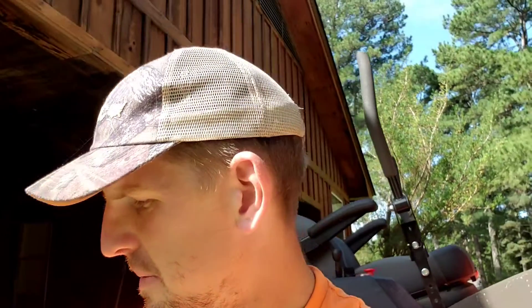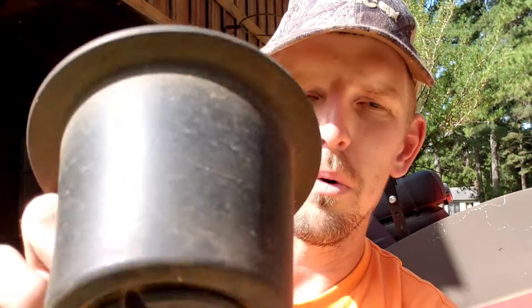That's what I wanted you to see, if your mower has these. Now, some old John Deers I've run had these cups, but they didn't have holes in the bottom — they held grease for your spindles. Now that's different; you may want to keep them. But if it's just for the purpose of a dust shield, I'd probably do away with them.